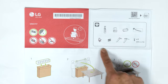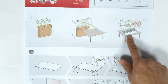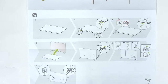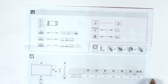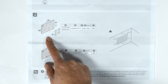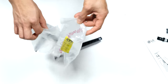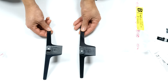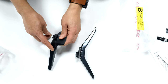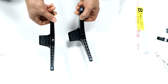The quick setup guide lists included contents and shows unpacking the TV on a large flat surface bigger than the screen so there's no pressure on the screen. Peel any covers off the back — there aren't any in this case. It covers attaching the feet, cable guides, list of inputs, critical dimensions, VESA mount dimensions, and a reference to the LG bracket — 200mm VESA, M6 bolts. The feet are marked A and B to locate in the corresponding positions on the TV. They're simple plastic pieces with a brushed metallic blue finish, with through-holes for the screws.